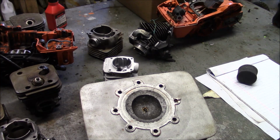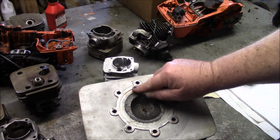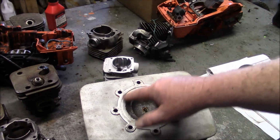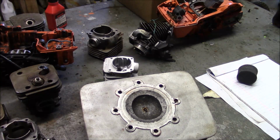Well, the motorcycle two-stroke guys have been playing that game for a long time. And if you look at the top of one of these pistons, you can see that it has a curvature, and they match the shape of the cylinder head to optimize that squish velocity to get as much of that mix from around here actually into the combustion chamber where it can actually be burned. The automotive guys figured it out sometime in the 80s. Two-stroke guys with the motorcycles, I think, had figured it out before that.